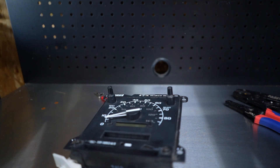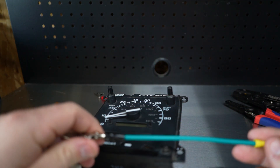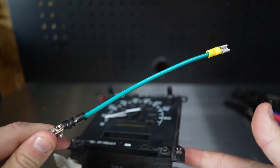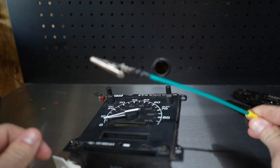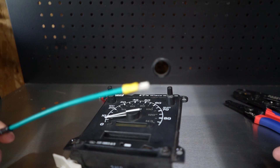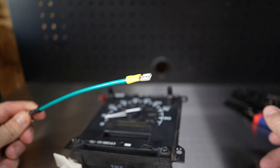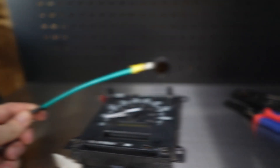In order to reprogram your PSOM, there's actually a little clip underneath the dash. If you have an OBD2 truck, it's right next to your OBD2 port. You're going to need an alligator clip and a female connector spade. Let's go see where this plugs in and how it works.